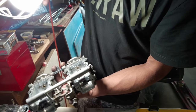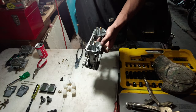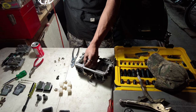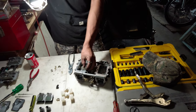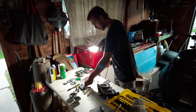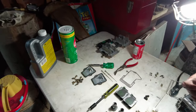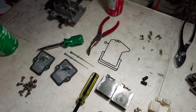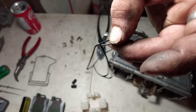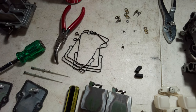It's ready for soaking. We'll put her in some CLR with water and some of the comet. I checked that comet can — it doesn't say to avoid aluminum, it just says avoid silver. Good stuff. If you want to get new gaskets for this — might not be a bad idea. Once you start to see a ridge on something that should be round, it usually means about time. If you go through all the trouble of putting it together, for a few bucks more, just do it right.